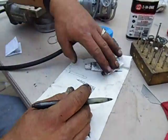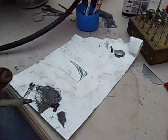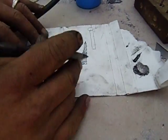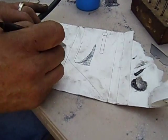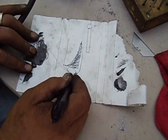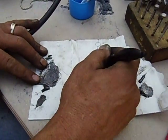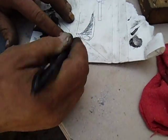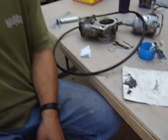Now I want to show you down here why it works. What happens is the air is moving on this side of the plate this way — it's being compressed. So if you look at that in the car, it's actually at an angle like this. The air is being compressed here, then it expands out against this, but you've also got the air coming down this way. So what you wind up with is a boundary zone here. Once you take this off, the air slides and it meets together, and this air actually helps compress it into the groove. So you wind up with a lot more power, a lot more air captured. I don't encourage you to do it every time, because if you make a mistake on it, then you're going to be buying somebody a new throttle body, or at least cutting them a new throttle plate, which is not the easiest thing in the world to do.